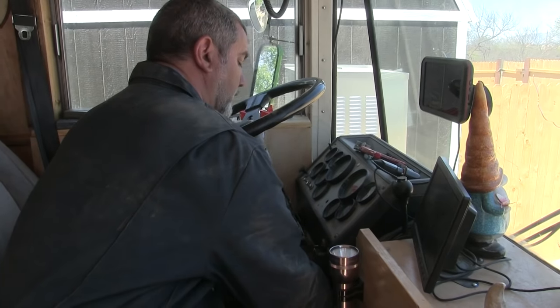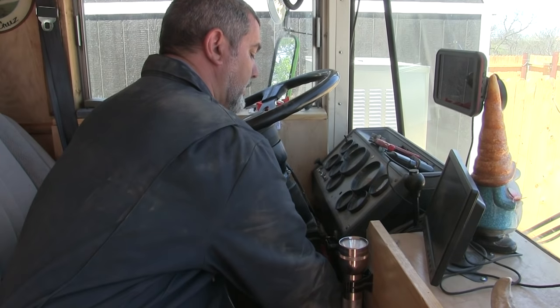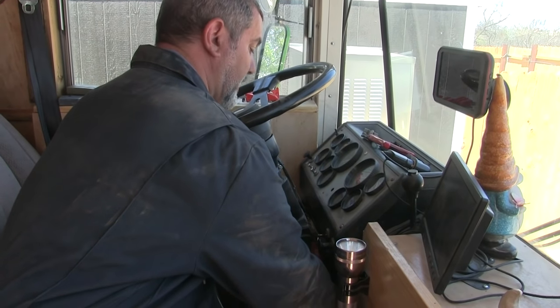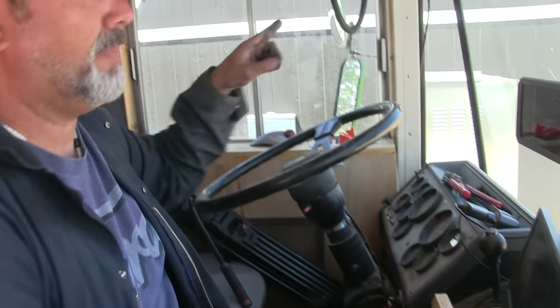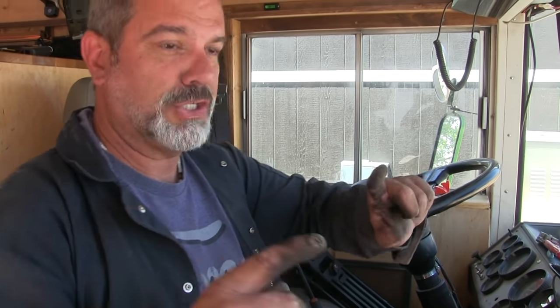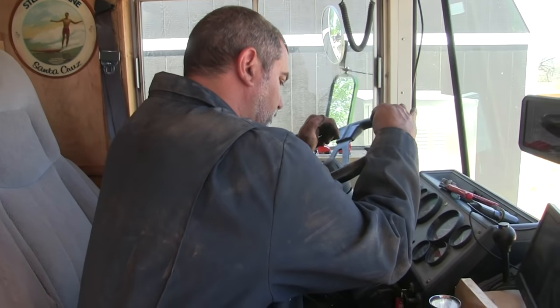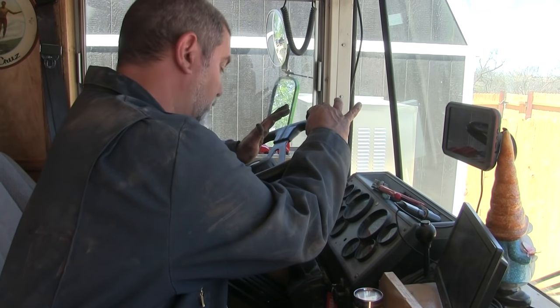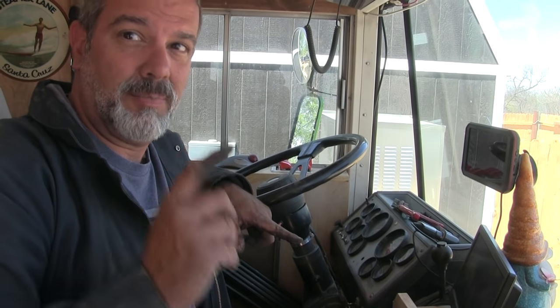So the part we just put in — the air pressure coming up paused at about 85 PSI because air that was normally going everywhere suddenly started filling up that auxiliary tank at 85 PSI. Everything paused for that tank to get up. But the air pressure is still climbing at idle and we're about to pass 100 PSI. So now we would actually pass an ADOT brake test.